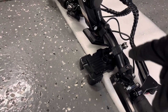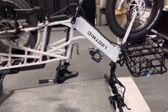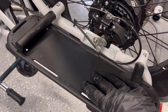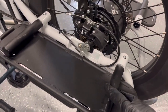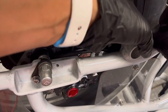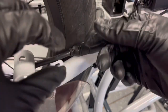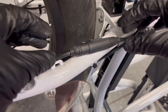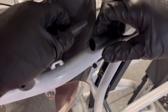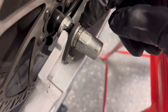Make sure any accessories like a cell phone mount are going to be okay when the bike is upside down. I should have removed the runner boards first because I need to access the axle, so I'm going to take those off on both sides. You'll also need a couple of extra zip ties because we're going to cut the existing zip ties to remove the motor wire in order to take the wheel off. For the cable connector, it's very important that you pull outward and do not twist — if you twist, you will break the prongs inside. Next, go ahead and take photos or a video of the spacer, locking nut, and washer layout on both sides so you remember the order.